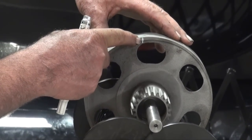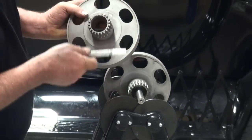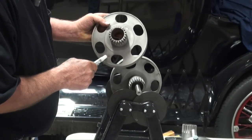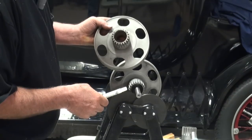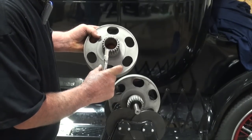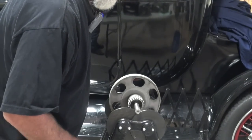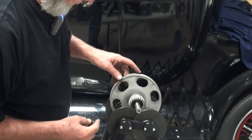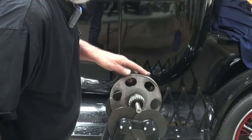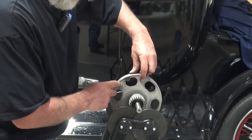Here's heavy. A low-speed drum, if the heavy spot was ideal, I've got two webs — if you drew a line through it, I could put a bolt here and a bolt here and probably, without a whole lot of work, get that taken care of. But I'm a little off of center, so I'm still going to pick the two webs. I'm going to put it on a weight. I know my little magnet is about seven grams, and if I just came up here and stuck seven grams there, it darn near stops anywhere I want. So I'm going to put them here.